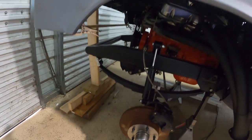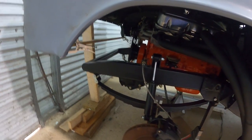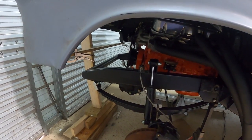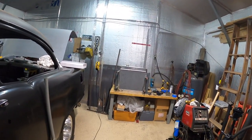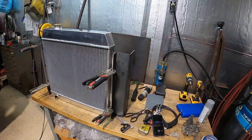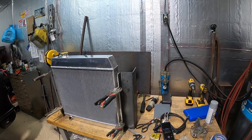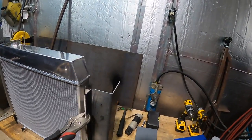We'll put the radiator up in there, clamp it, and drill some pilot holes — two on each side. Then pull the radiator and brackets back out, open these holes up, insert a nut inside the frame, and tack weld nuts on both sides. We'll already have the holes laid out on the bracket so we can just bolt them on. That's the plan, we're gonna try that and see how it goes. Once I get these holes drilled with the radius wheel I'll get right back to you guys.